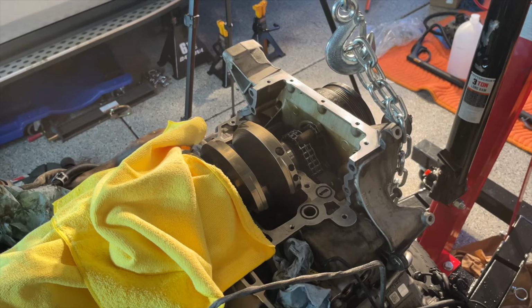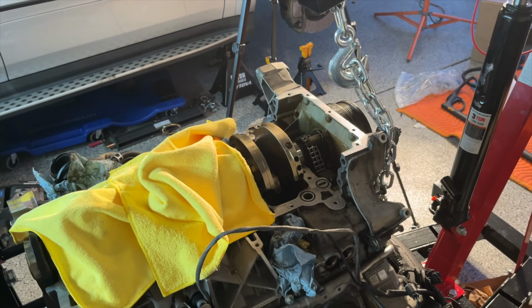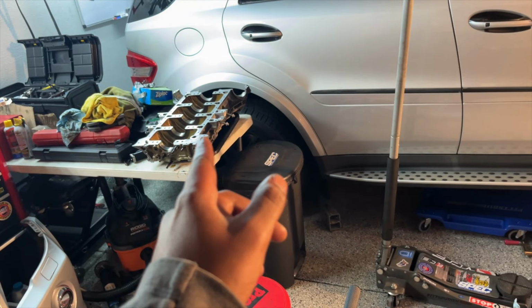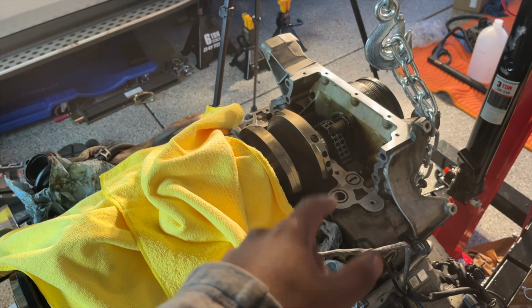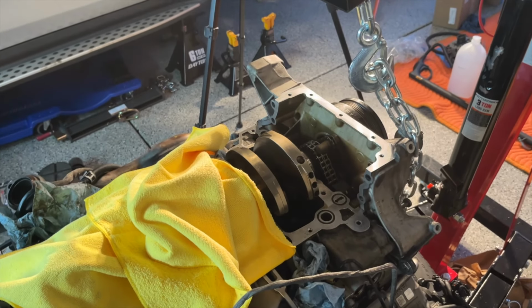One thing I found kind of odd was I found this Mercedes video posted online for technicians clearly outlined putting the sealant on the bed plate cover first, but when I looked into WIS, WIS had a diagram of just the block, and it had a labeled sealant pathway. I'll put that picture right over here.